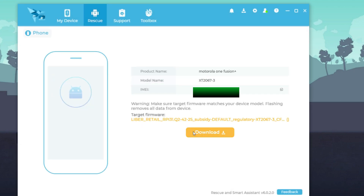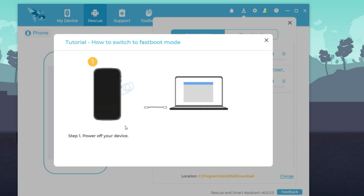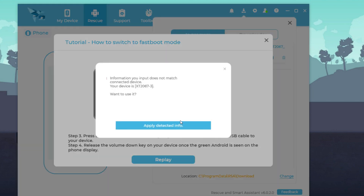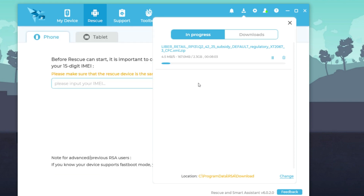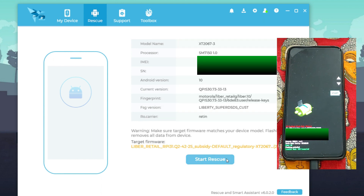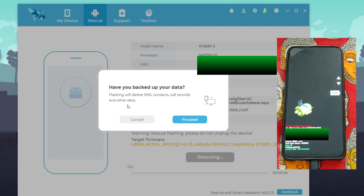Click OK and it will show the latest ROM available for your device. Click Download and OK. If you have already downloaded the stock ROM it will start flashing; otherwise it will download the ROM first. Then power off your device, connect the cable to the laptop, and enter bootloader mode by pressing Power and Volume Down. I am speeding up this download part. Make sure you have at least 50% battery before doing this process. It will take some time to download and flash.